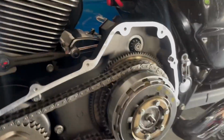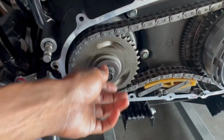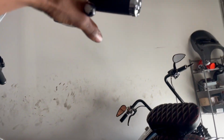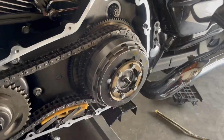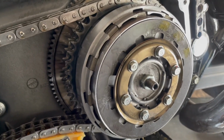So we got the primary fully back attached. Besides the starter bolts, we're gonna do those. We got the whole front end assembly torqued down and Loctited, also the back. Now I'm gonna show you guys what I was doing right here. We're not done. I'm gonna take this off and hit this to the powder coat today. So I'm gonna show y'all real quick. When you pull it in, showing you how it flex.